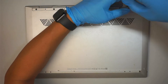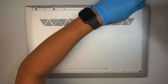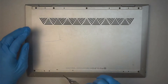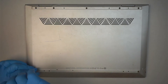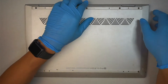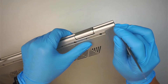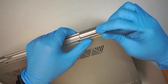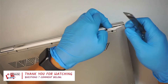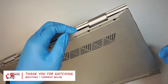Using a Phillips screwdriver, just unscrew all the screws here. We need to remove the back cover to get into the screen. This is a request from the audience on YouTube — one of the comments asked if I can do a video tutorial on how to do a screen replacement on this HP Envy x360, and this is how it's done. If you have a request, please comment below. Make sure you subscribe and like the video if I was able to help you.